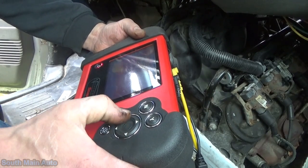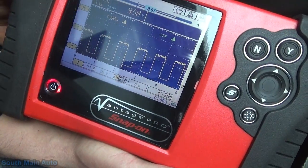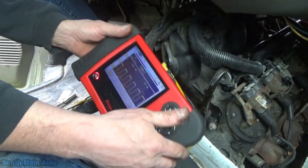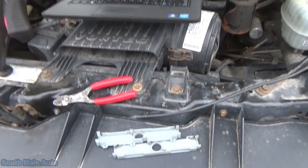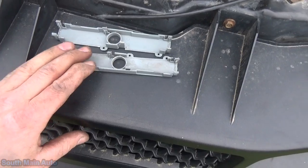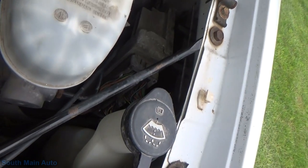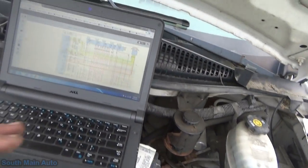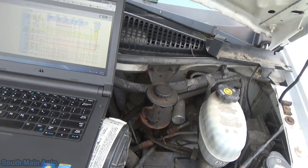That's the only thing that has me a little bit concerned, but we are cranking it so our cranking voltage is going to drop it down. It does appear to be pulling all the way to ground, which is important. I'm curious at this point if we have crank signal now, because supposedly the crank sensor is also new. We'll come out here under the hood - I managed, four hours later, to get our ECM covers off. These things are a bear to get off, particularly without breaking them. There's our ECM hiding down there in the corner.